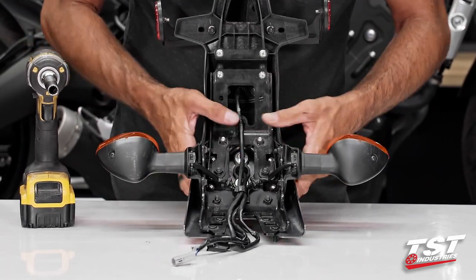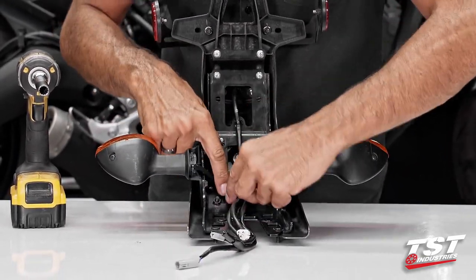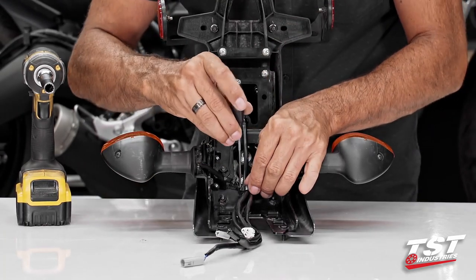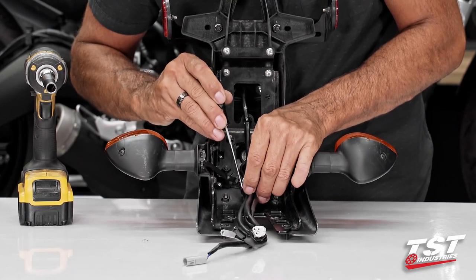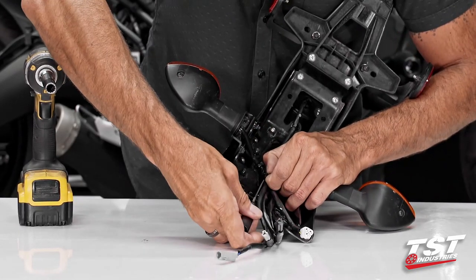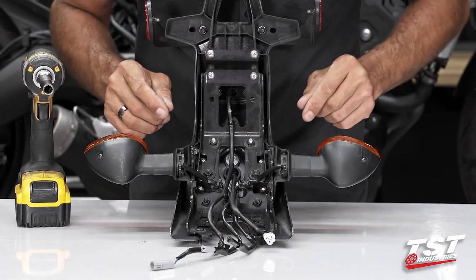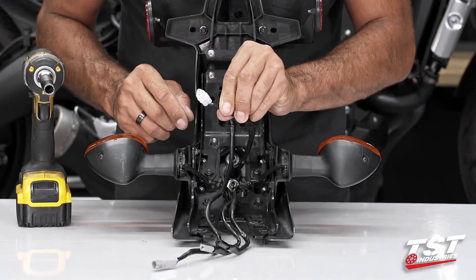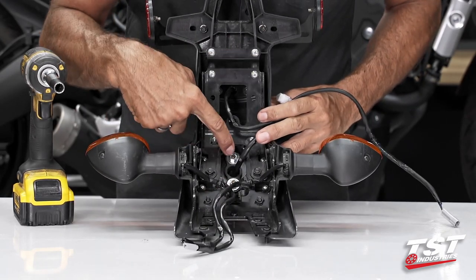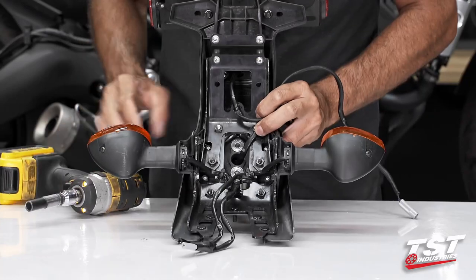At this point, we have to take out the taillight. This taillight inhibits our ability to remove the outer fender that we will be keeping, so the taillight does have to come out. We have this cable management clip here that has dual closure that comes together with ratchets — we're going to have to clear that out. Now if you do end up damaging this, it is not a part that gets reused, so that's pretty okay. It's also a clamshell design — once you open it, it just stays together. This white three-conductor plug is the one that we're going to concern ourselves with.